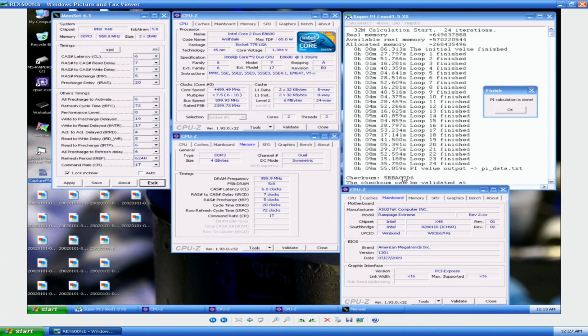Then I tried high FSB SuperPi 32M. I made one very quick screenshot at 600 FSB, and at the higher frontside bus speeds the north bridge voltage actually scales and works like it should. The maximum high FSB SuperPi 32M I was briefly able to do was at around 640 FSB, but then I really hit the CPU FSB limit.